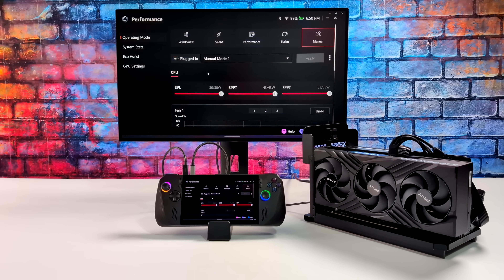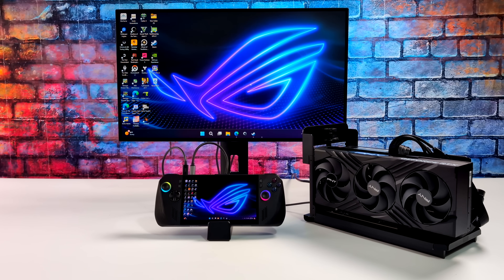Super easy to get this set up. All I had to do was plug in the eGPU and download the Nvidia driver. There are a couple other things I like to do when in dock mode — I definitely want to make sure we're getting enough performance out of this Ryzen Z1 Extreme. It doesn't make sense to plug all this in and run in quiet mode at a 10-watt TDP on the CPU side. So we're going to head into Armory Crate SE Performance, set to manual mode and max everything out. We've got a sustained TDP of 30 watts, for two minutes it'll do 43 watts, and for 10 or 20 seconds it'll do 53 watts. While gaming we're probably going to be sitting around 30 to 34 watts.